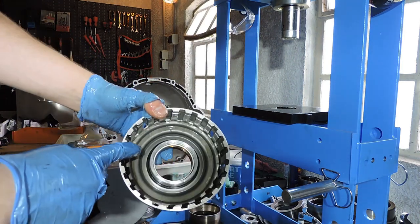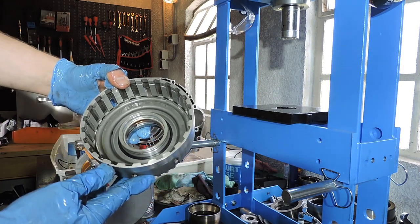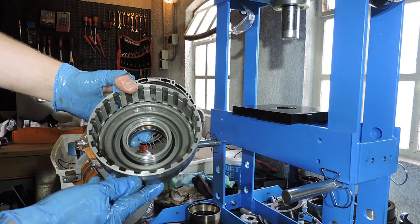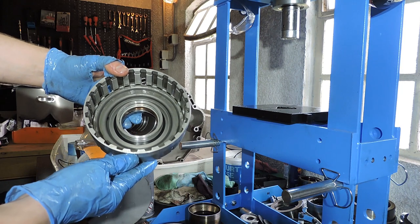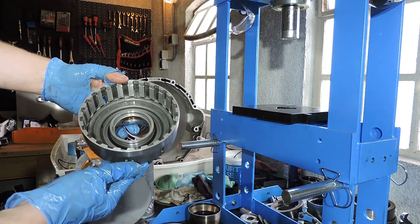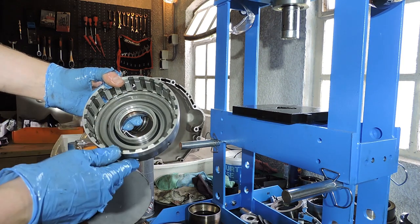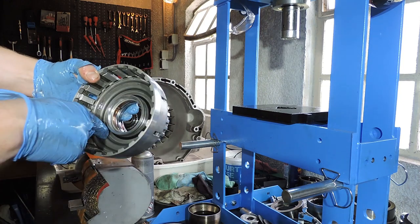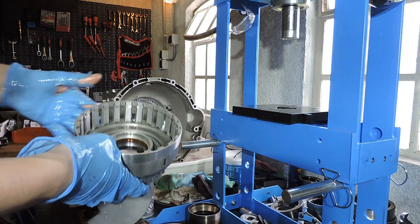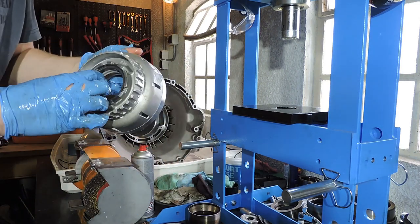This is the old molded rubber piston. It's in good shape, it's not leaking. These molded rubber pistons tend to develop leaks around the vulcanized rubber on the inside and on the outside. It is recommended to replace them, but if you cannot source the parts because your transmission is old and your suppliers don't stock these parts anymore, under the condition that the vulcanized rubber parts look good, you can just reuse them. On the 5HP24, however, one of those pistons is notorious for leaking, so with that transmission I would recommend always replacing the molded rubber piston.